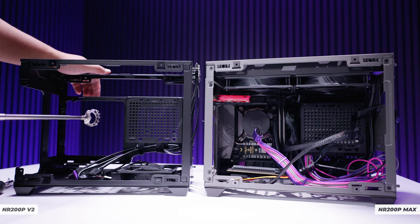Here's the elephant in the room with this video. When we used this motherboard last time for another build, we used a Cooler Master SFX power supply and this board just did not work. Oh, I have a feeling, hear me out, this motherboard hates this power supply. Every time I've used this power supply and this motherboard together, it hasn't worked, but I thought it might be different this time. Well, with this Corsair power supply, it's working, but there are some issues with this motherboard.